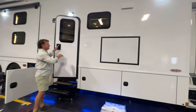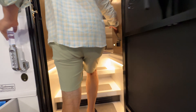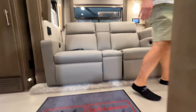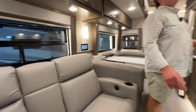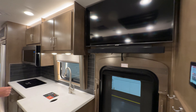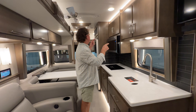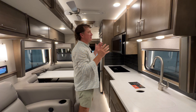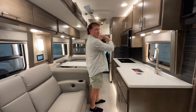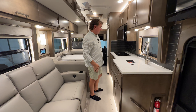Outdoor TV, dual awnings up top. I take that back in regards to doing the Starlink over the entry, just because we have the TV right there. From here, we'll basically do it right up in the electronics cabinet — everything is really easy to get to right there. You do have 110, and really there's no service issue with the Starlink. We like to put the antenna as far forward as possible, so if you're backed into a camp spot, you don't have to contend with a whole bunch of trees over the front of that.